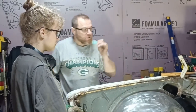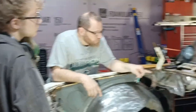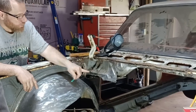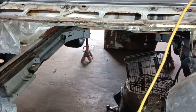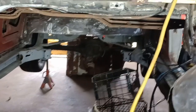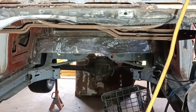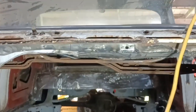Pretty much right now it's looking like all we're going to use out of that firewall is probably the center section over the tunnel. We'll build to that, and then we'll probably build off of a couple bosses — the one for the steering column, the throttle cable, and a couple other pieces — and that's where we'll locate our pedals and controls off of that. Then just about everything else in here is going to end up being fabricated.